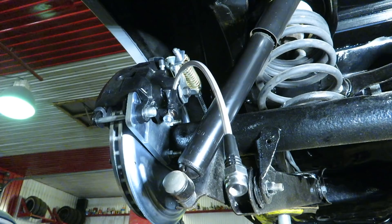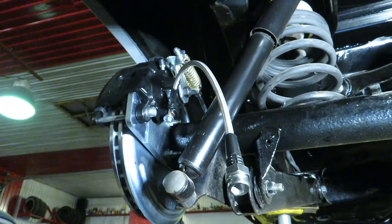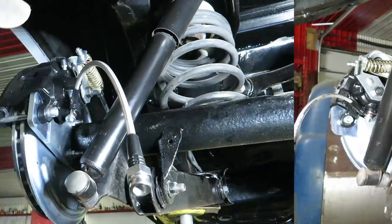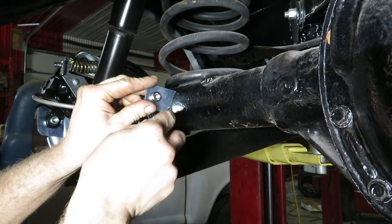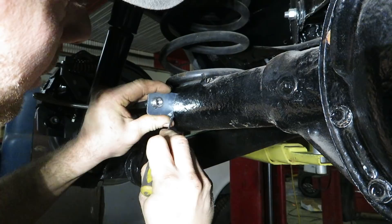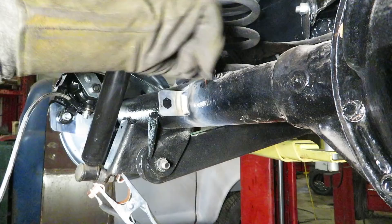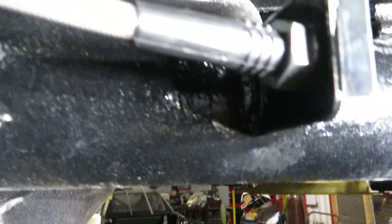Look at how nice that is. It's nice having a fun, fast car — it's nicer knowing that you can stop it and not kill yourself or wreck your car. Now you might notice this flex line here that was never there before — that's a way to connect to our brake line. We do have to weld this little tab here. We're going to go around the shock, straight back — the exhaust comes up around to the outside of the frame. We'll scratch that paint off and weld that tab in place. Don't forget your little clip in behind the spring — it comes in from this way, and that's kind of what that should look like.